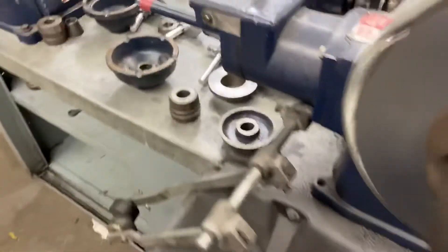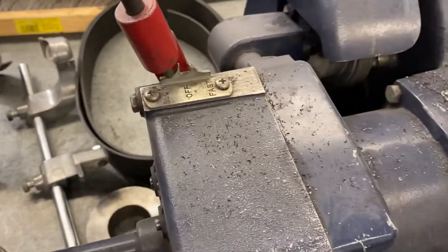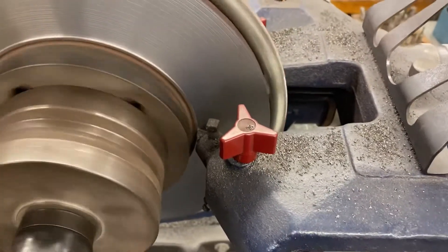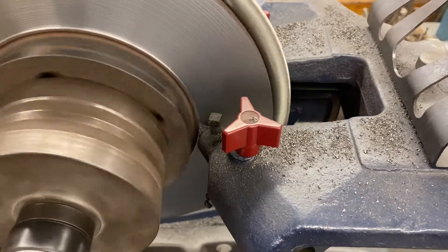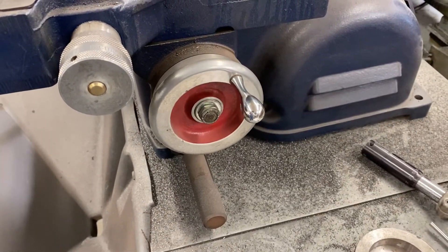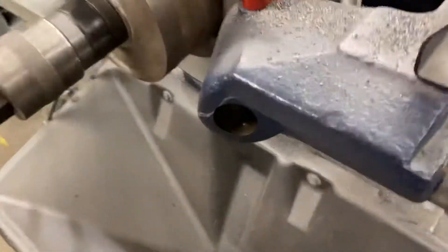This time I'm going to lift this up and move it to the slow speed and let it cut that surface. That gives it a very fine finish that your brake pads will enjoy rubbing against — won't wear the pads out. Look how slow this thing is moving. This step takes about five minutes to complete, so you don't have to necessarily babysit it as it's doing it.